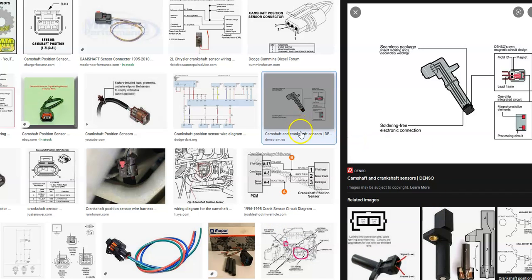Keep in mind that wiring can cause the same problems as a bad sensor. Also, there's usually a fuse on this circuit somewhere — usually inside the engine compartment fuse box labeled something like SNS or Sensor 1. Sometimes it's under the dashboard too, but usually in the engine compartment. Depending on the year, design, and engine type of the Dodge, there could be a blown fuse, especially if there's a short in the wiring.